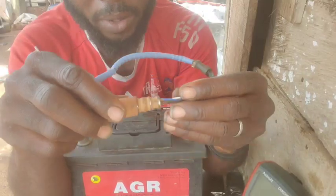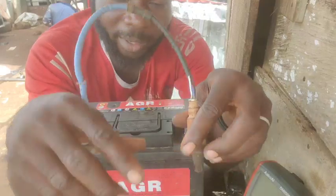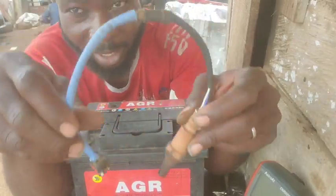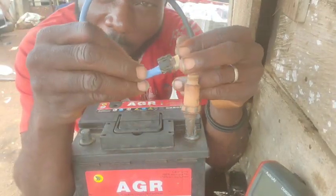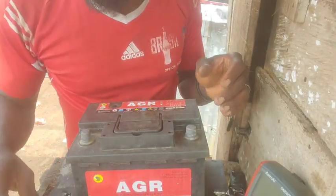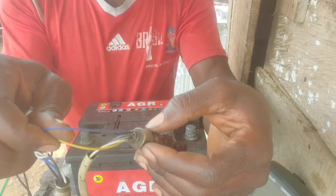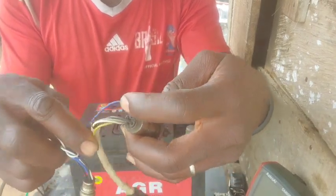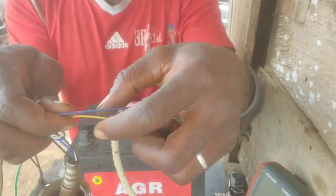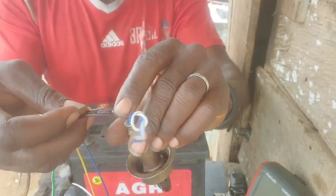In today's test, you'll discover how the heater circuit fails and how the ECM detects that the component is no longer competent, triggering error codes like P0043 — the low circuit heater code — or the check engine light. For the five-wire sensor, the blue and yellow wires are the heater circuit. The white, gray, and black wires are the signal wires. Connect the yellow and blue to the battery terminals to perform the heater test.